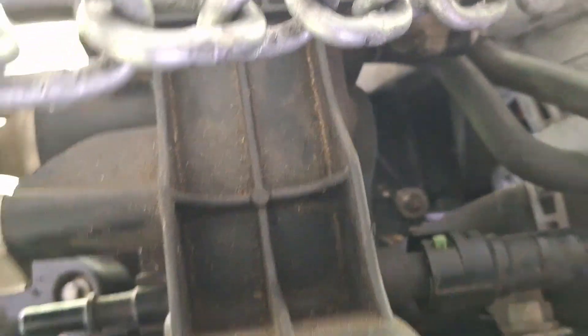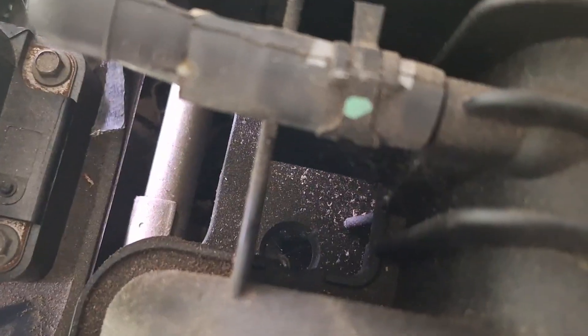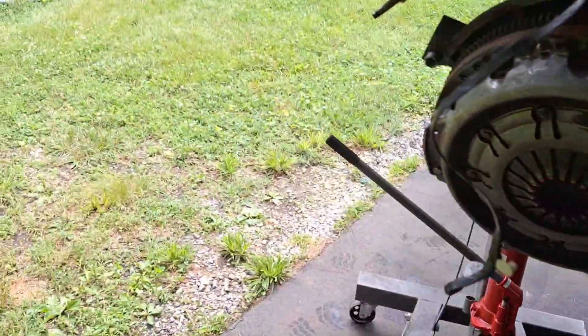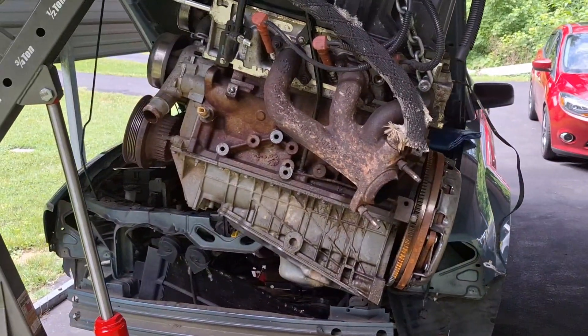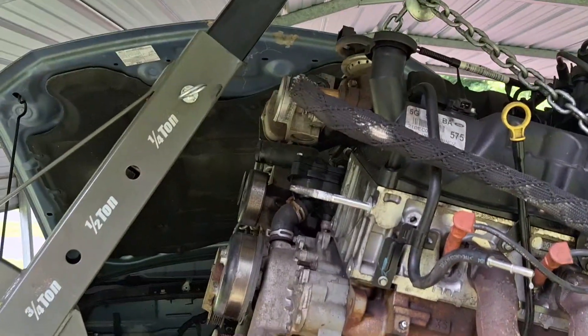The engine's out. If you want to take the intake manifold off, it's held in with a series of torx screws — you can see them down in there, and there's a direct line of sight on each one along the top. Take all the wires and stuff off and it'll come out. Stay tuned next week where I tear this engine down and see how bad it is — I'll probably pull the heads off and maybe the connecting rods. If it's destroyed I'll take it all the way apart. Thanks for watching.